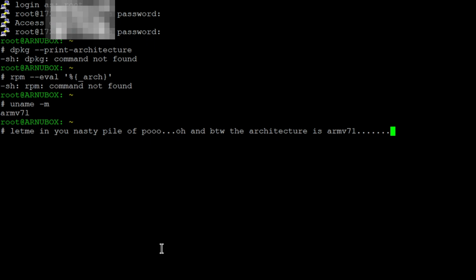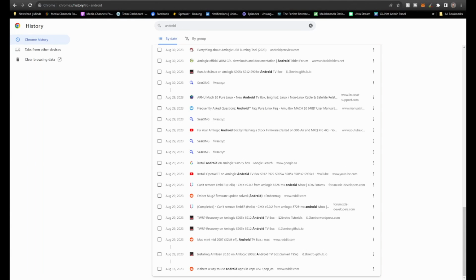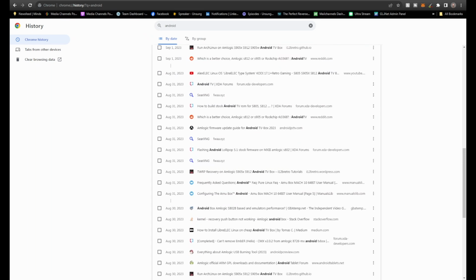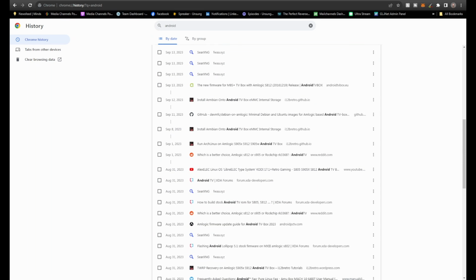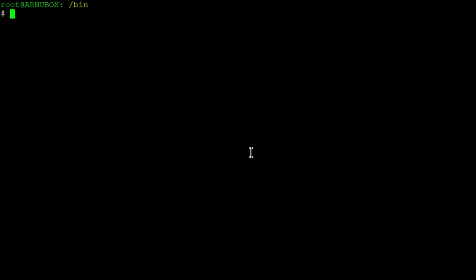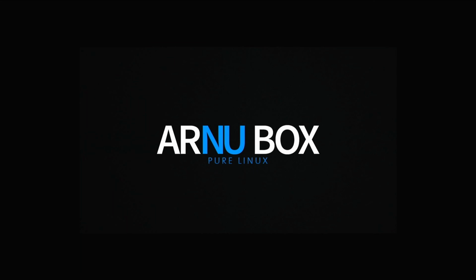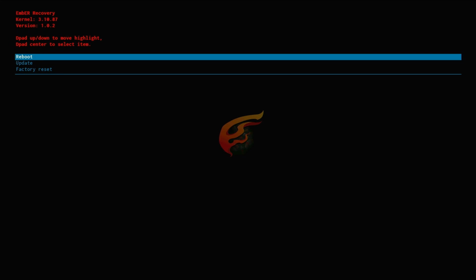I went through many images from different OSs, and I wasn't exactly angry, but I was already a couple of weeks into the project and not making much headway. And the fact it took me forever to figure out I had to hold down a reset button on the inside of the audio port to be able to boot from an SD card didn't help. And if the image didn't work with the particular hardware, it wouldn't boot at all, or it would reboot into the Ember recovery mode instead. So I wasn't getting anywhere.